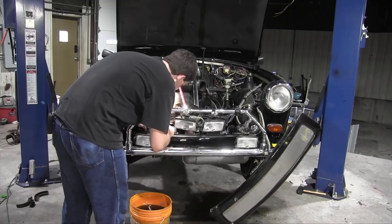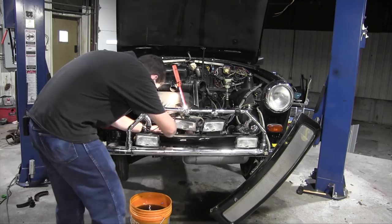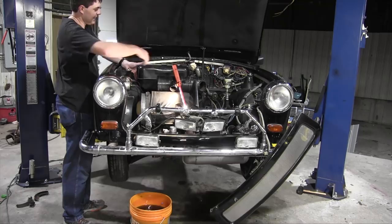The float valve assembly appeared to be in excellent shape. However, that being said, the float bowl was completely empty, devoid of all gasoline. So, something was wrong and I cleaned it out. This is a theory I have yet to test, but I think getting the fuel line on the bottom of the gas tank will be easier with the gas tank out.